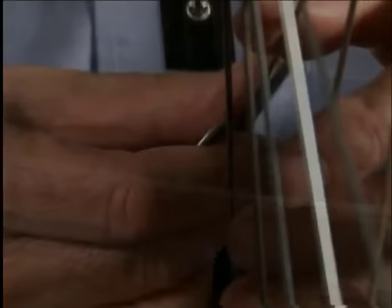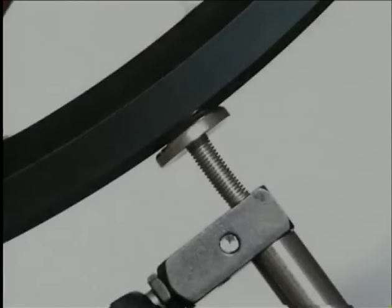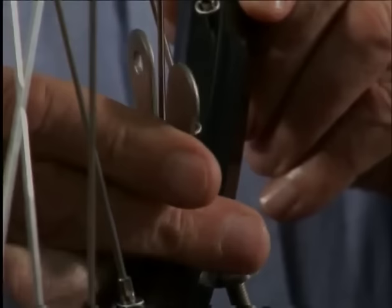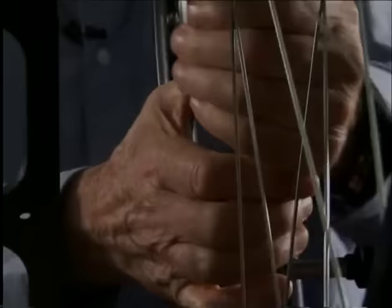Absolute tolerances in the circularity of the wheels are often discussed. It doesn't make sense to make assertions. What's important is that the wheel keeps its circularity. A wheel that stands does not have to be retrued later on. The absolute tolerances depend upon the quality of the rim and the final spoke tension we're able to bring up. Soft, unsatisfactory work soon reaches a tolerance of almost zero. The wheel may look good, but it has no durability. It'll be necessary to re-true the wheel several times later.